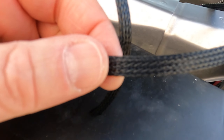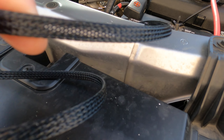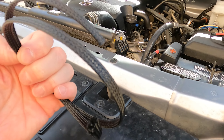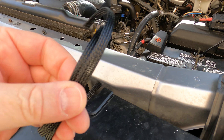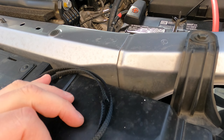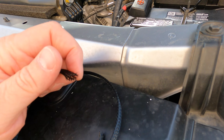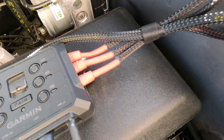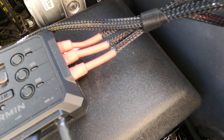It is hard to get the wire to go into the loom, but if you squeeze it together like a slinky it will go right in. It just kind of gives it a nice look and protects it. Then you can put the heat shrink tubing right over the top of the cut part and make it look really nice. This works for me. And don't forget — reach out to me and let me know about the grounding. If you know a better way to do it, I would really appreciate that.